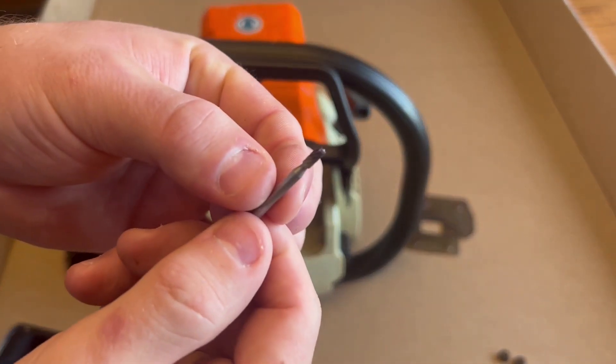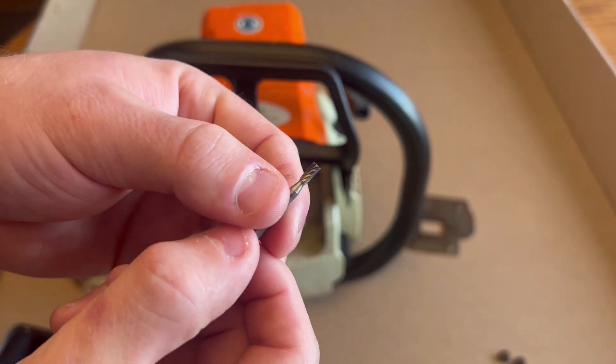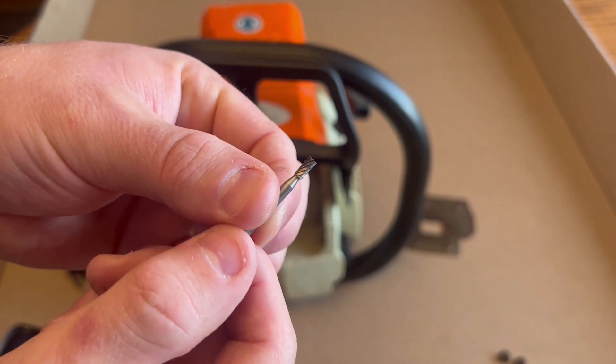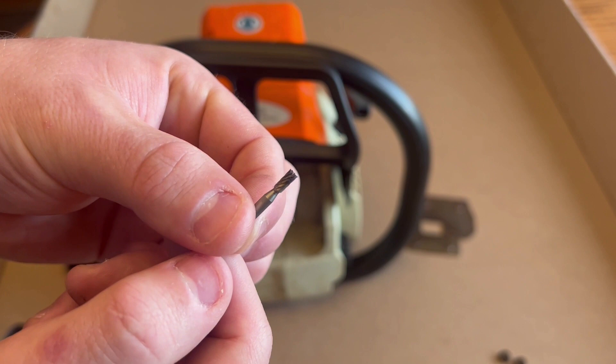This is the tool I used to cut those out with. It's probably hard to see, but you can tell there's some discoloration — it got really hot. After watching a few videos, it's best to use cutting fluid, and you do not want to build up heat, so take small increments — that's what's best.